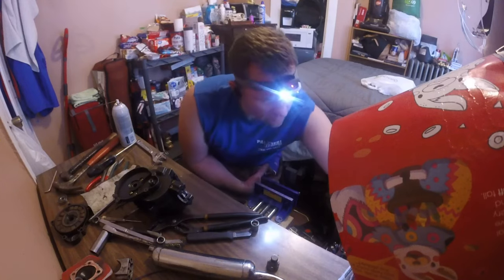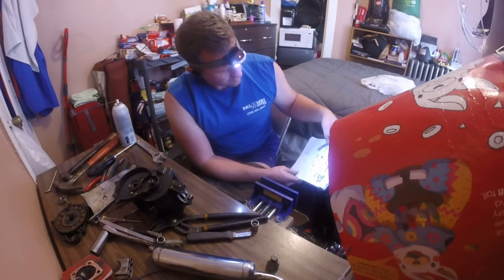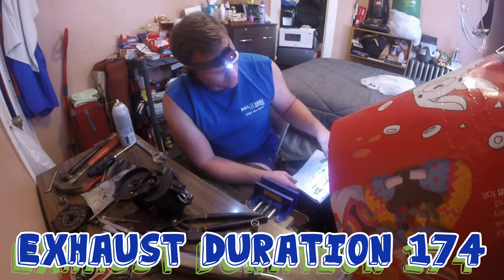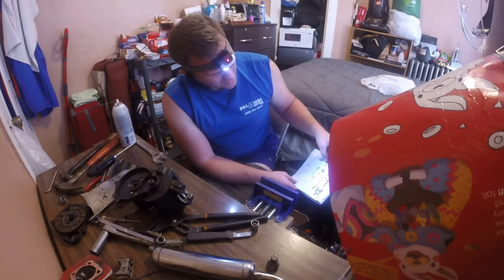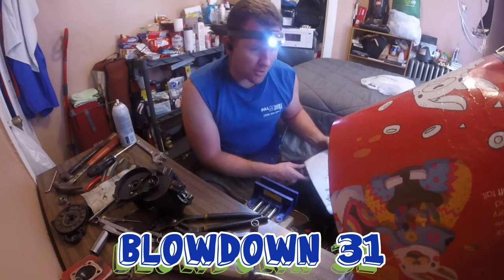I'm sure of that. For reference, so you guys know what we're dealing with, I did the port timings. Exhaust opens at 87. The duration is 174. Transfers open at 118. The duration is 124. Blowdown of 31.